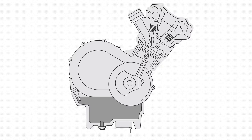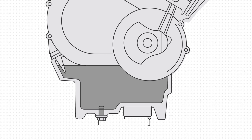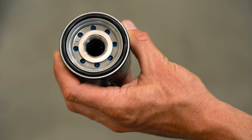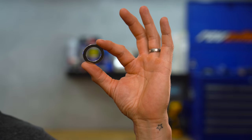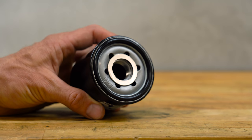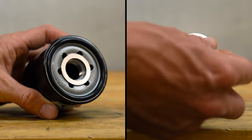The last point about magnetic drain plugs is that they're not in a great position to do their job well — they're down in the engine sump where the oil just sort of sloshes around. To really be effective, the magnet needs to be in the oil flow, which is why I run a magnet on my oil filter. Donut magnets like this one from Motion Pro sit right on the oil filter, so they're exposed to all of the engine oil and get the opportunity to snatch every errant particle. These work on spin-on filters as well as cartridge filters, and they're more effective than magnetic drain plugs. But if you're serious about protecting your engine, just run both.